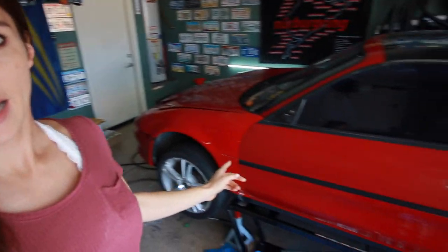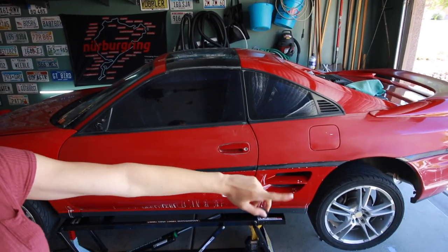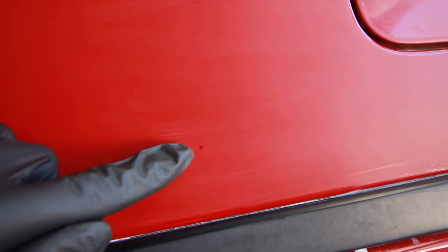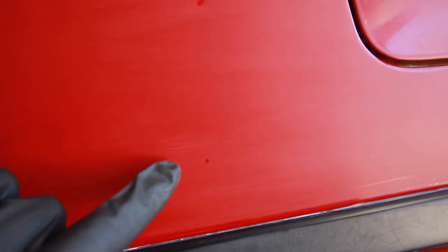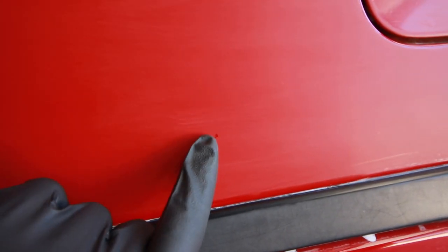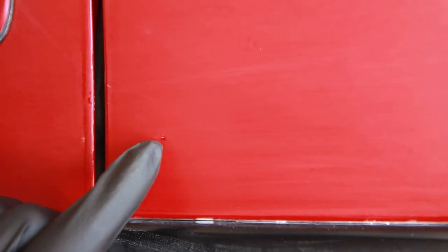So that's where we're at right now. I have the door and part of the rear quarter panel wet sanded. I ran into a couple of issues: right here there are a few fish eyes as well as some chips in the clear coat. What I need to do is get some more clear to fill in these areas so I can wet sand over them — the base coat is still there, it's just the clear that's missing. I just need to fill that area and then wet sand over it.